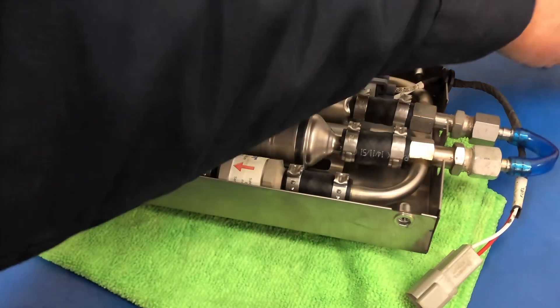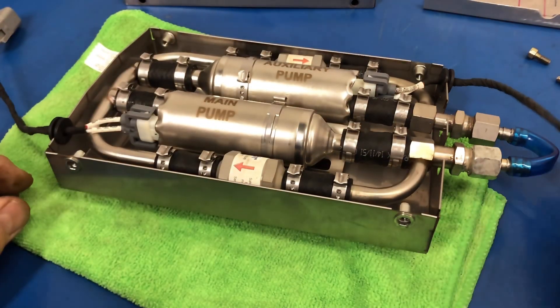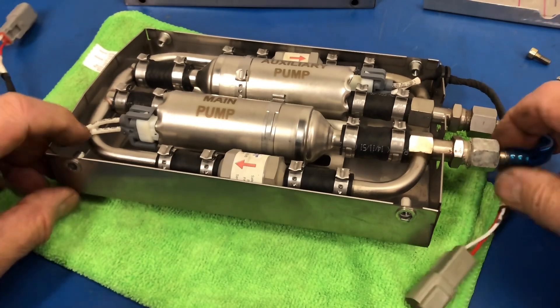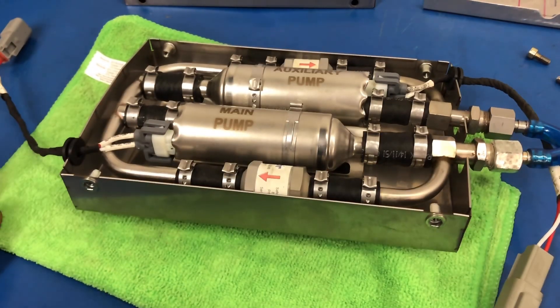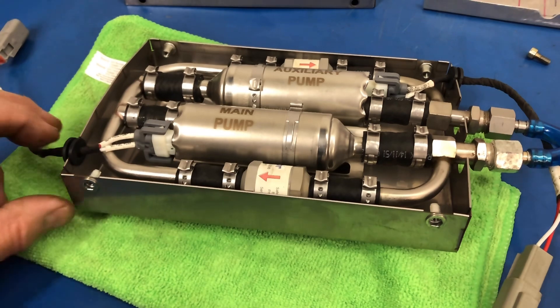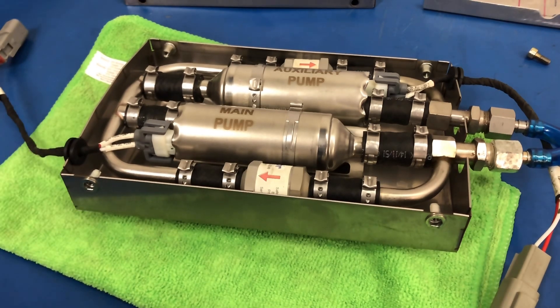However, if it had the right nut on it, or the nut had been turned with fingers instead of a huge wrench, maybe things would have been different. This was discovered when this fella had bought the airplane — so this is from the previous aircraft owner. This is a metric fuel pump assembly, so it should have had metric bolts, and maybe it had quarter-inch fine bolts on it. Anyway, got to fix it now.